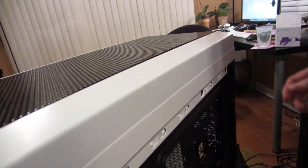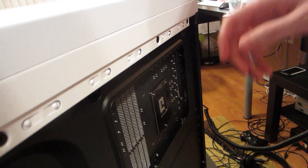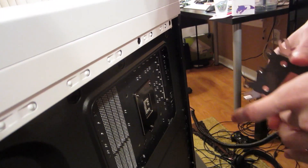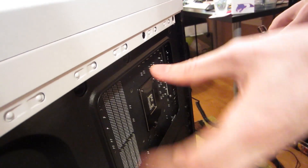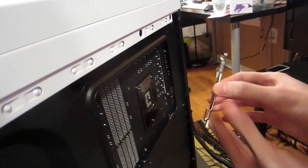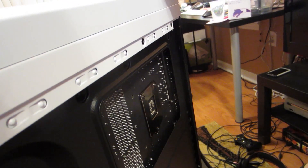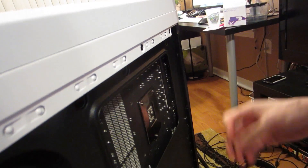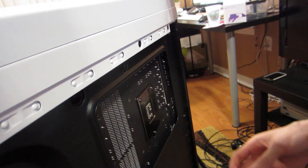Now what we have to do is mount the back plate onto the back here, because I have this really fancy case. We can actually just attach it without having to remove everything. Generally, if you want to install an aftermarket CPU cooler, you have to take your motherboard out and attach it to the back. But because this case has a back plate cutout, we can actually do it without removing the motherboard. We just have to insert these standoffs from the other side coming through, then attach them with some nuts. I'll just hope I get everything right.